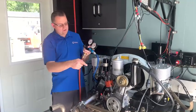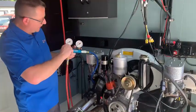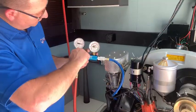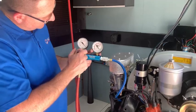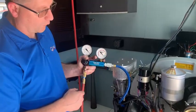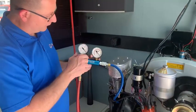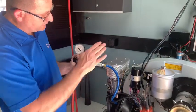We've got the crankshaft locked here. This is a Total Seal leak-down tester. I'm going to adjust it up to about 100 psi so we've got a one-to-one reading. Thanks to the fine folks at Total Seal for building a really awesome leak-down checker. What you see here at 100 psi is 0% leak-down — zero — after 14 hours of run time, and this engine is hot. The cylinder heads are still at about 200 degrees after running and doing all the other cylinders. 0% leak-down, sealed up nice and tight.